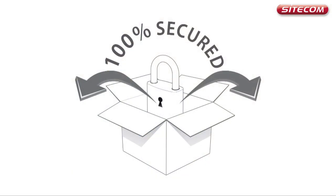Just as with all our other routers, the 3G router's wireless network is already protected. If you use a Sitecom wireless network adapter, you can create a secure connection with the push of a button. If you do not have a Sitecom network adapter, you can find information about the wireless network on the sticker on the bottom of the 3G router. Select the network and enter the password to use the wireless network from your notebook. You can also share the mobile internet connection with other devices such as smartphones in the same way.